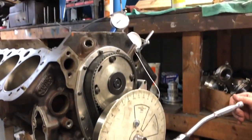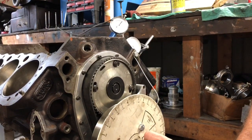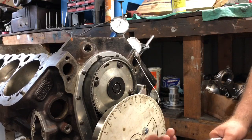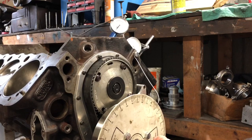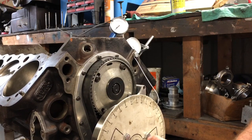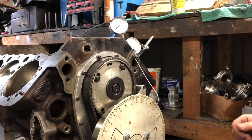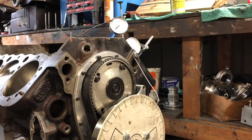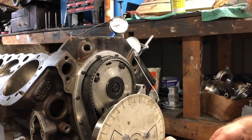I'm on 50 again — I'm at 71. Pretty close, 71. At max lift and going back down. I bumped by it again. So 71 plus 148 — let's see what we got: 71 plus 148 equals 219, divided by 2 equals 109.5.